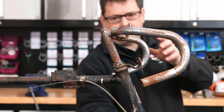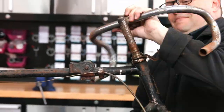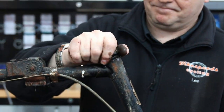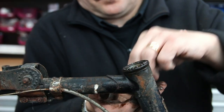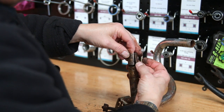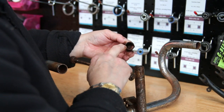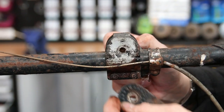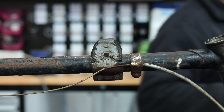Now this was intriguing — I knocked the quill, which is normally enough to get that handlebar stem out, but it was a real pain. Eventually I got it out, but then as we were stripping the forks we realised the quill itself, which has a U-shape, was completely rusted through and had just snapped off the bottom of the stem. That stem is toast. We could have put a new groove in, but we didn't know how far the rust went — fortunately we had a replacement stem.